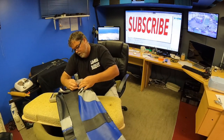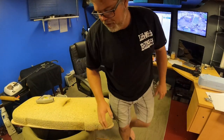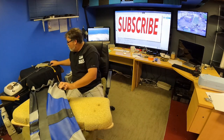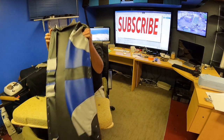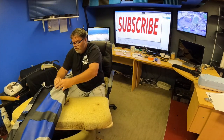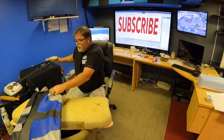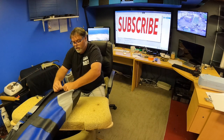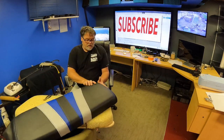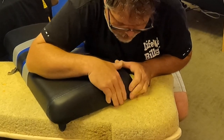We're getting into a lot of material here — it's going to be tough. So on the sides we're getting into quite a bit of extra material but we should be able to get it out. We might have to do a little something here — pull these back out. As you see in the corner we got a little extra material, we got to try to get those knots out. It looks like we're going to have some little stretch marks — I know the factory cover I took off even had some stretch marks on the side. That's a pretty nasty corner — we have to add some heat to her. Heat will shrink this vinyl a little bit.